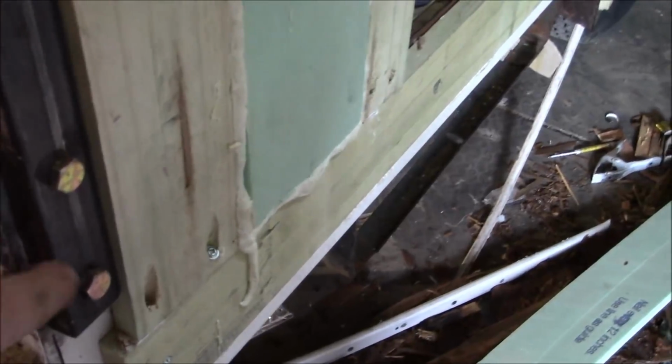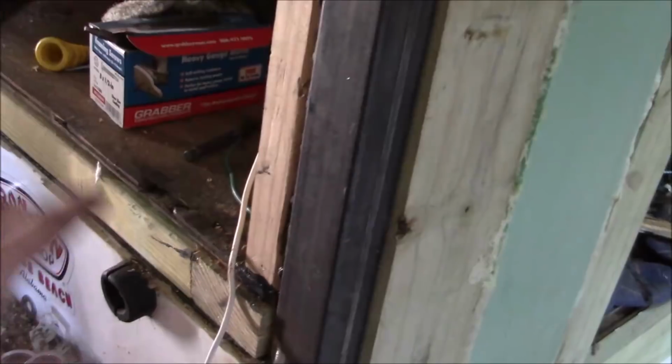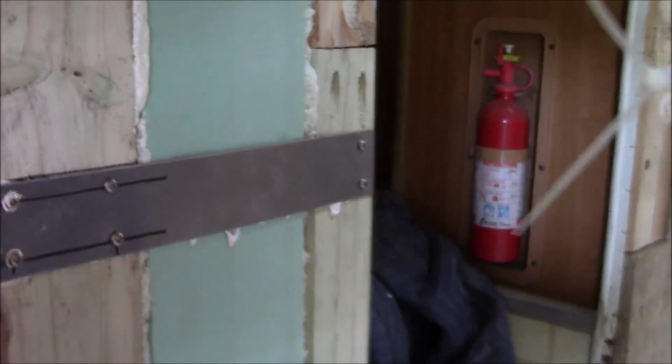It'll be okay. Over here on this side, to pull this whole corner assembly together, we used grade 8 bolts right here. Those go through the bumper, because the bumper actually bolts on. I mentioned that earlier, but the bumper actually is bolted to this. So we got a 2x6 here, 2x4 here, and then we put the piece of steel in that's carrying that load. So now when this jack comes up, this whole steel is going to be able to pull everything together in concert like it should. And then we glued it. You can see all the glue we got in there. Everything is glued and screwed, glued and screwed, glued and screwed. We'll put our skin on there, and then she's going to look real nice.